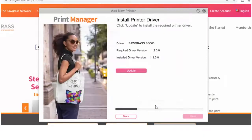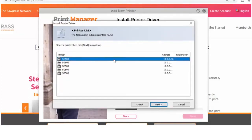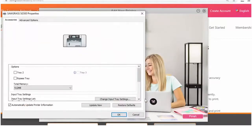You can either add your printer using USB, Ethernet, or Wi-Fi if you have an SG500 or SG1000. If you are installing with USB or Ethernet, plug your printer in and follow the prompts on your screen. If you are installing with Wi-Fi, make sure your printer is connected to the same network your computer is and follow the prompts on your screen. Agree to install the printer and rename it if you would like. If you have a bypass tray or an extra option tray for your printer, now is the ideal time to install it.